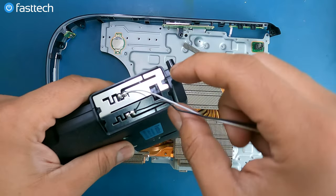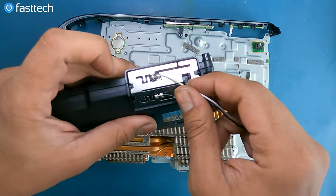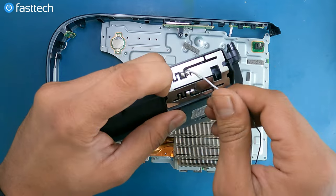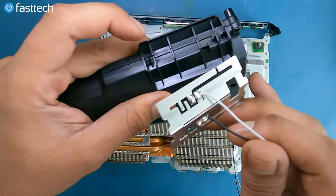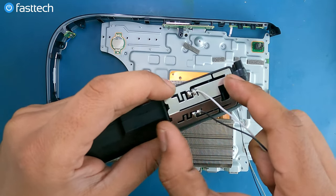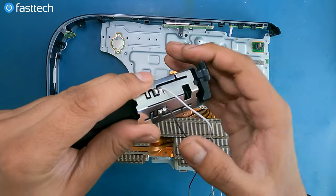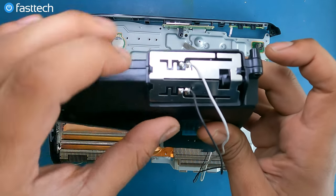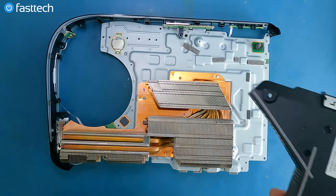You will have to put your own antenna on the power supply because we don't include that. Remove the antenna by pushing down on this clip, depressing it on this side, and then simply lifting it up — boom, like that. Then install it back the same way you removed it. There's a little clip on this side that it goes under, and then you just push it down.